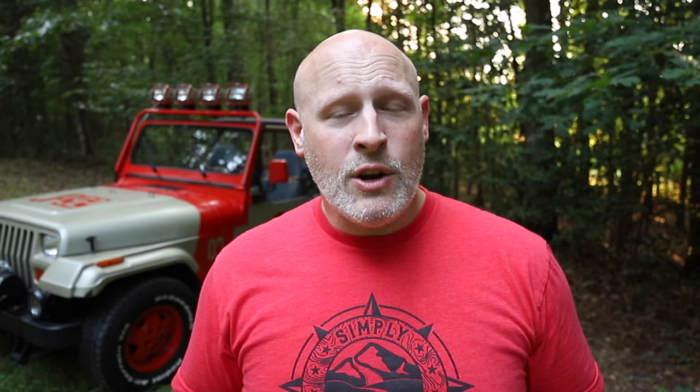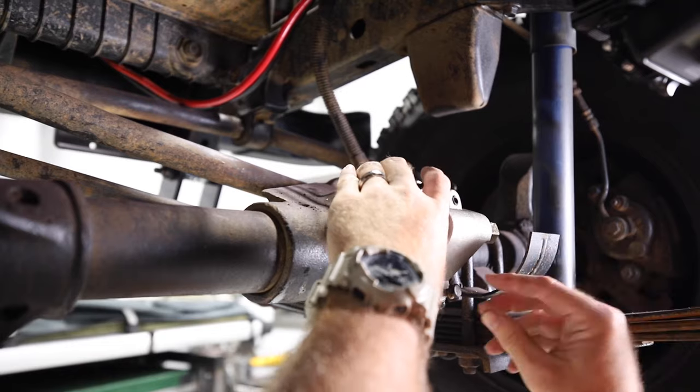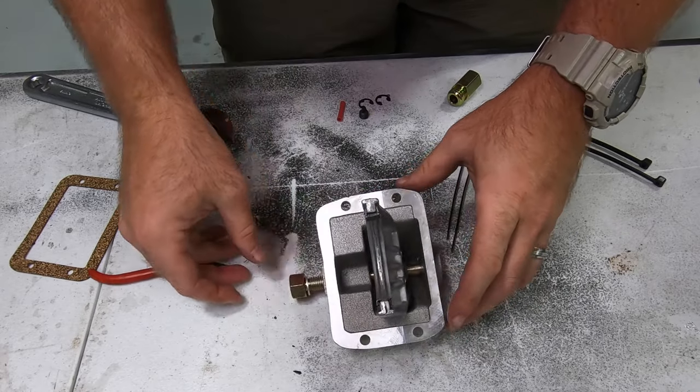There have been some issues with the cable system and I don't like adding extra things into the cab, particularly when I'm trying to keep a stock look. The way I did it was to take out the entire option of that ring sliding and permanently mount that ring in the orientation that locks those axles together. There's really no downside — there's a hook that kind of locks everything into place. It's a very simple project, and I have an entire tutorial linked here.